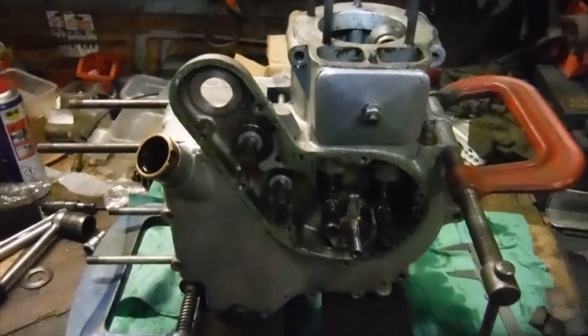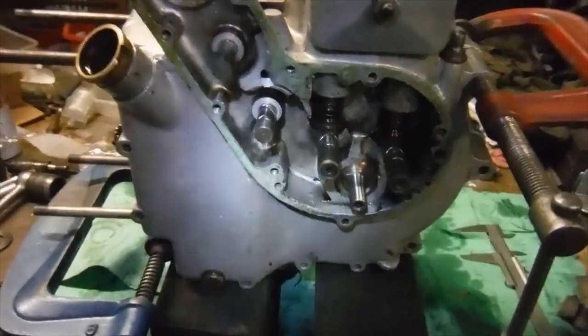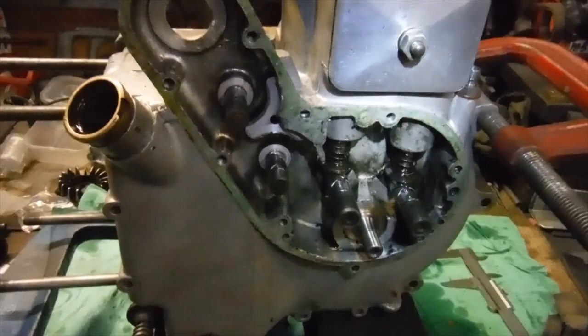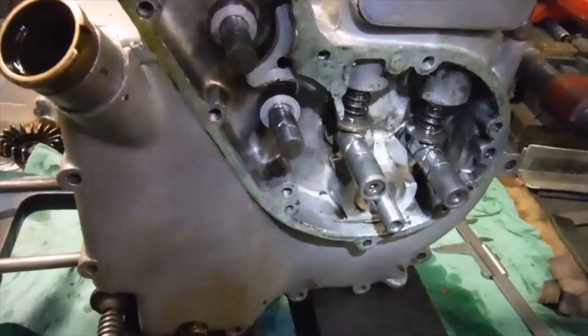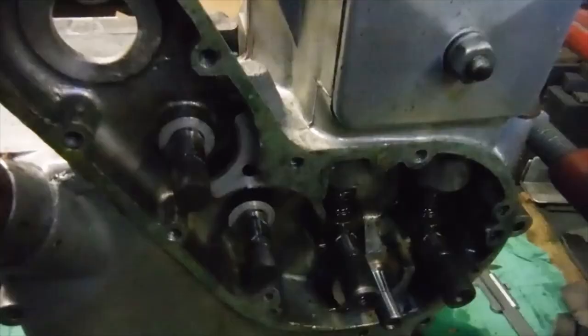Here we are with the trial assembly of the 1951 Royal Enfield Bullet 350 G2 bottom end. The bottom end is from the bike, which I've had all sorts of fun and games with. We've seen the crank reassembled and tested between centres in the lathe, and I had another go at that in my last clip where I actually got it to a point where we had no run out showing on one main shaft and just 2.5 thousandths of an inch on the other. So I decided that that really was probably as good as this old crank was going to get.